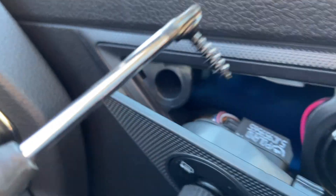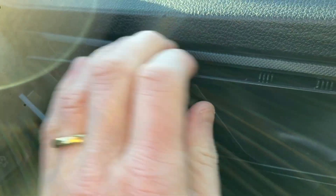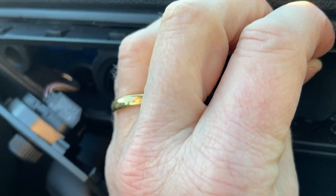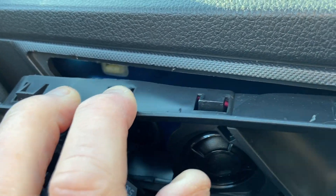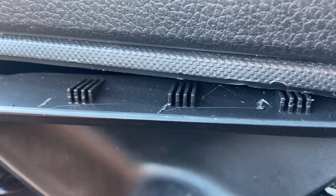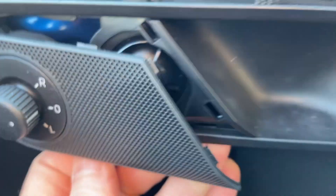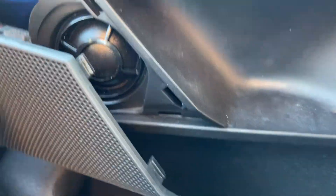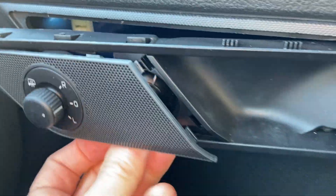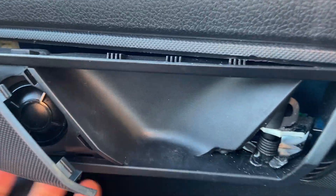There's the screw. By wedging apart the door and the panel you can get the top to come away, which gives a bit easier access. I'll gradually just work my way around - the plastic clips come off. It doesn't really need much of a screwdriver, which is good to protect the trim, so I'm just gradually easing the plastic out.